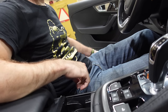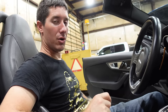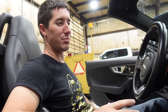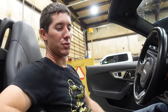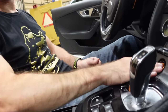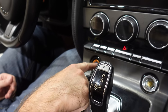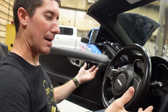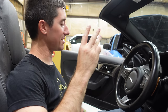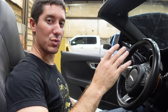Other than my little corner where I knocked off a little bit of the black paint, the rest of it looks great. My advice: don't use too much alcohol and don't push too hard — you can get the coatings and paints off the plastics. I was using little bitty spots of alcohol about that much, just a fingertip, cleaning out each switch. The start-stop button is way better. With all the options to clean up your interior: alcohol is number one, makeup remover number two, WD-40 number three — only ranked that because it leaves an oily film. And the worst one by far is hand lotion. There are a lot of recommendations for hand lotion online, and I would say avoid that one.